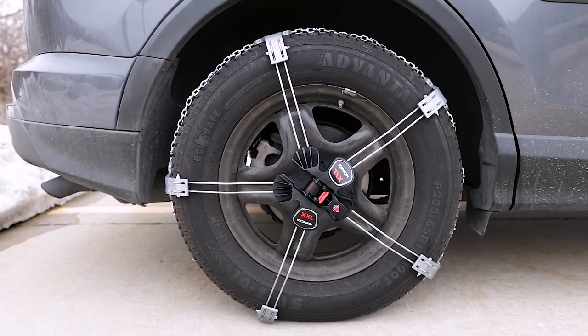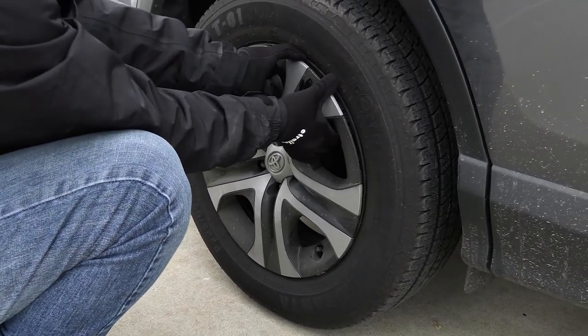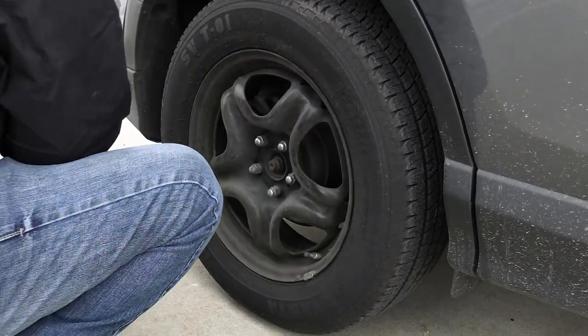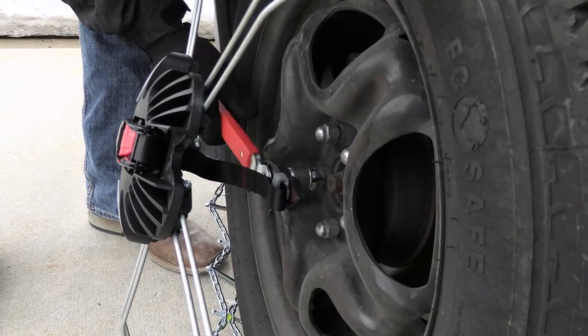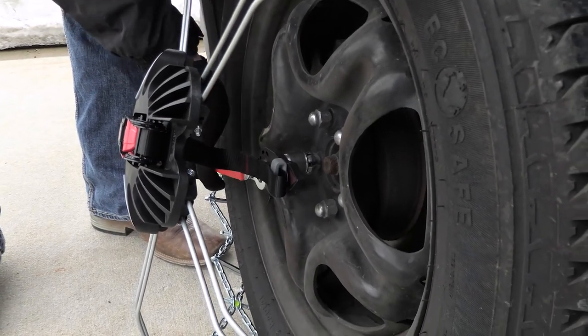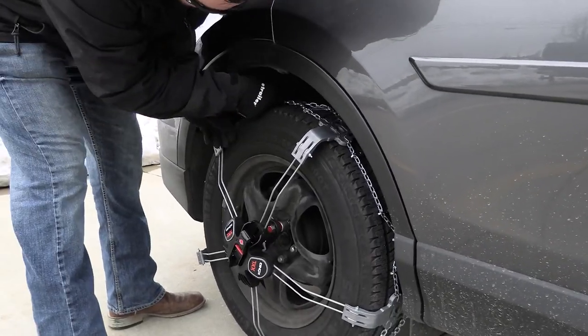The no-clearance tire chains are going to be the hardest by far to get installed. You're going to have to remove the hub cap face, attach the clamp to a lug nut and tighten it down, get it placed on your tire, pull forward, and then readjust it so that it seats nicely on the tire.